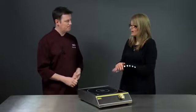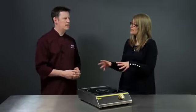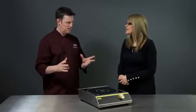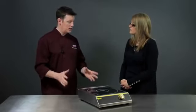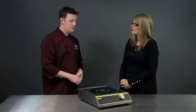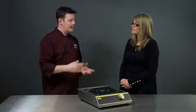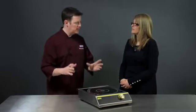So what do you currently have at home? I have a sort of glass top, but it glows bright red constantly. Right, so when you turn it on, it's the hob that gets hot, not the pans, is that right? Yes. This works slightly differently in the fact that induction doesn't actually generate any heat in the machine itself. The heat comes from the fact that it sends out an electromagnetic signal, and when you put something which is magnetic on top of the hob, it's that thing that gets hot, not the hob itself.